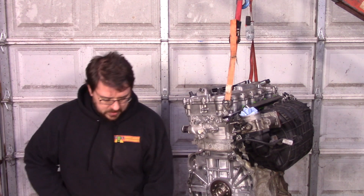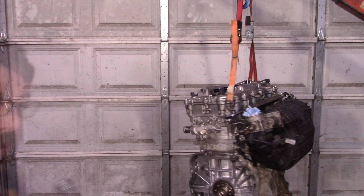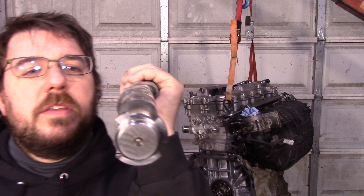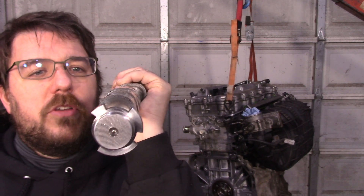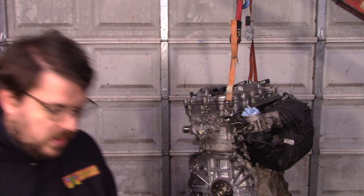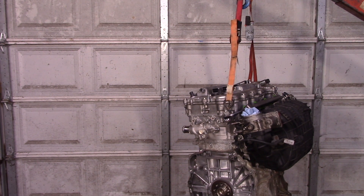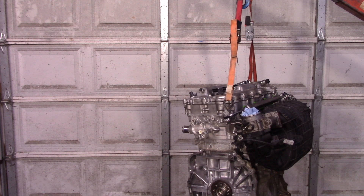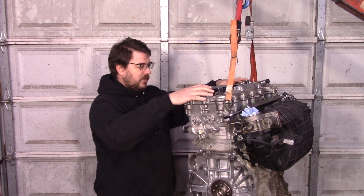Here's another one — it doesn't look that asymmetric. Let me grab a different one that looks more asymmetric. This one's my biggest grind, and you can kind of see it on camera: this side is a little softer than this side. It's all about managing the energy, the reciprocating weight going up and down, and not needing a whole lot of spring rate, because extra spring rate is just lost energy — and worse, it turns into heat right on the journals for the camshaft, risking damage.